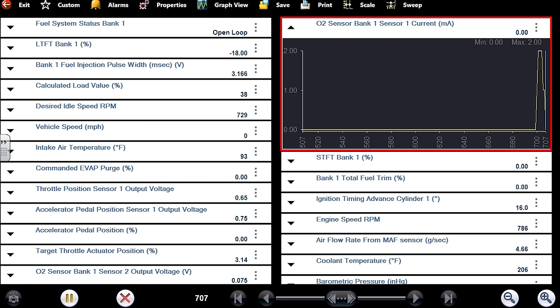If I can get rid of that learned trim, the car should not stall. Battery disconnected. Calculated load is at 25%, low idle speed, rough, and I'm in an open loop fault mode. Rev it a couple times — not a great backup strategy but the fact that it's that much better is notable. Let's see if we can get this sensor warmed up. At about 500 RPM — you'd think it would try to raise the RPM. Let me pull the desired idle parameter.